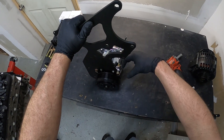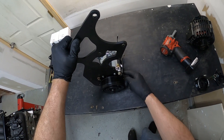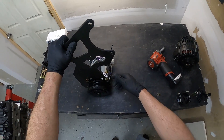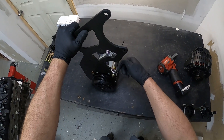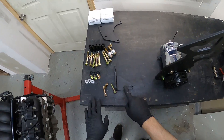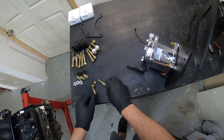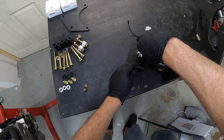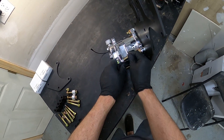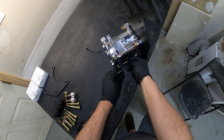There may be slight bending required for this line to go down and around the compressor. So for your installation, depending on which chassis you have and different power steering lines, you may need to modify this line with slight bends, but everything else should work just fine. The next thing we're going to do is mount our rear compressor bracket. This is going to get mounted in this orientation on the compressor with two bolts and two nuts that are included. Do not tighten these all the way up yet — we'll want them loose in the car so we can install it.